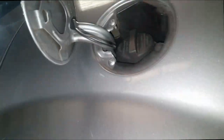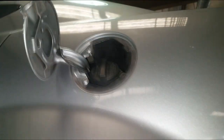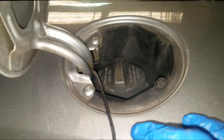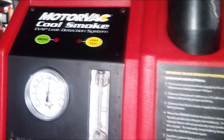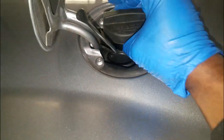It's been past five minutes and the ball will not drop, so I will turn on the smoke portion of the machine. From there, ladies and gentlemen, all you do is look around for smoke coming from wherever the leak should show up. In this case, it is coming from the fuel cap. You can see this cap won't even twist — it won't even click — and I have it on as tight as possible. The customer says she just replaced it. Look at all this smoke coming from the fuel cap. My pump is still pumping, still pushing smoke into the system, and the smoke is escaping past the gas cap.